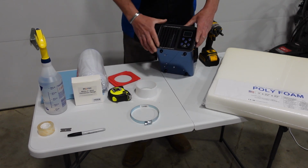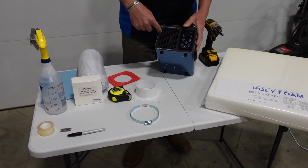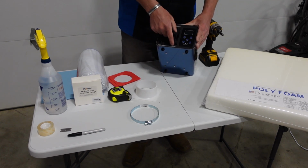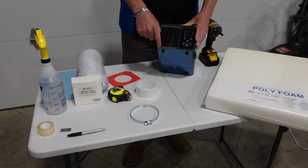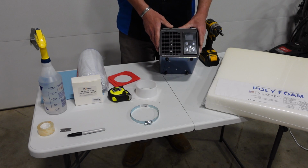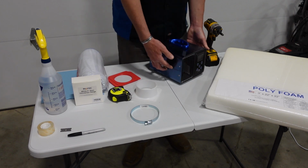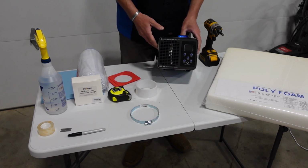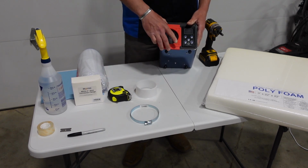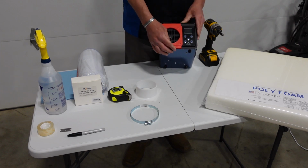And one thing to keep in mind, this is cheaply made. There's no gasket around this surface. So what you could do is run a bead of RTV or silicone caulking to take up that gap. I may end up doing that, but I want to avoid it if possible, because that's going to make it more difficult to pull this half off so I can service that plate. So for now, we're just going to install this and be mindful that ozone may escape from here.